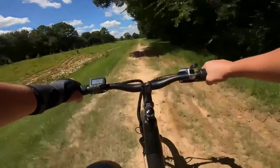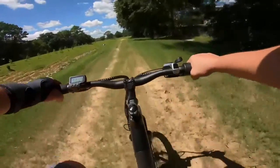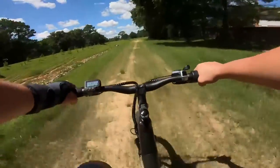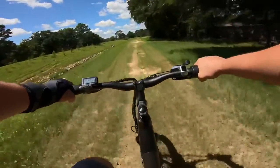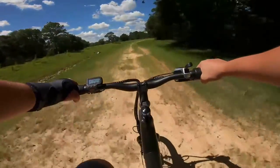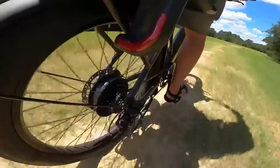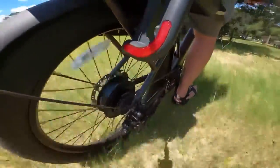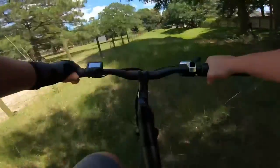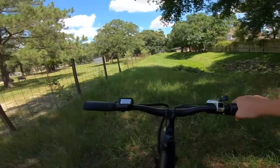The bike handles these off-road trails very nicely. Just a couple of ruts and a little mud — easy going on those three-inch tires. Once we start hitting some bigger stuff you start to feel it more since we don't have any suspension. If you were riding solo with just the basket, you could add a suspension seat post, which would really bring up the ride comfort quite a ways.